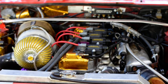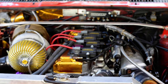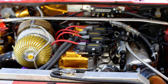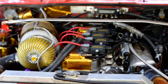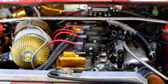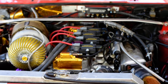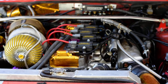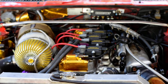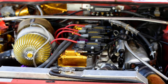On a stock TBI setup I was able to walk an M4 on a straightaway with 15 pounds of boost — 93 octane, a 50/50 mix of 93 octane and VP Racing M1, 15 pounds of boost, running two 1200 cc injectors, a Super AFC. Still automatic, with a full exhaust and a super 16G turbo — just bolt ons. And I was able to walk an M4 on a straight.